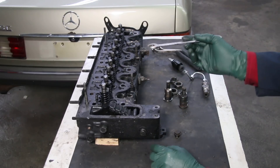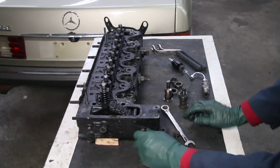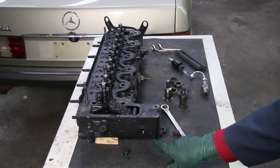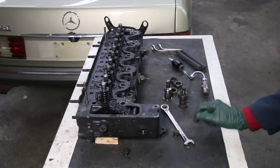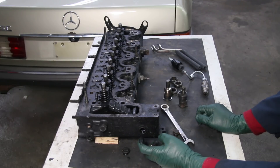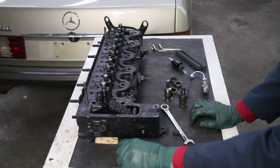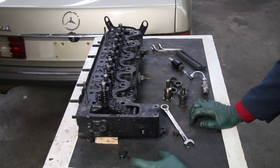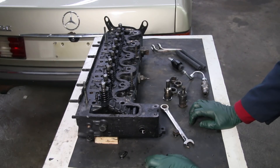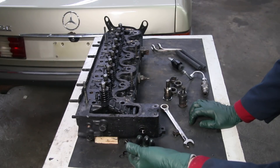Let's see how tight this one is. I went and looked at some of my other cylinder heads and it was actually loose. That's hardly even tight. When this falls out, you're going to be leaking oil, and if you happen to have a loose pin that's not tight, that pin could fall out, the sprocket could drop down, and you're going to destroy the front of the engine. There are also a couple of larger plug nuts down lower in the engine block — check those for torque as well. These are loosening up due to high vibration and high mileage.